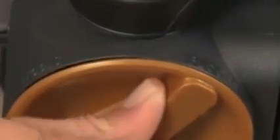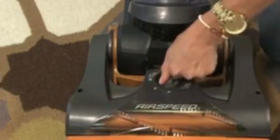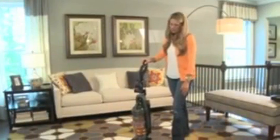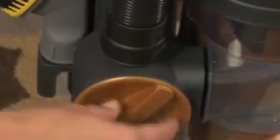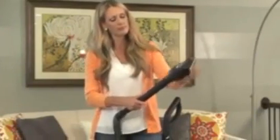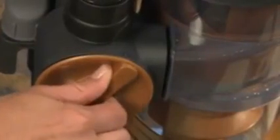To prepare your vacuum for cleaning floors, turn the Airspeed Airflow Control Switch to Floors. The Airspeed Ultra has a carpet height adjustment, which is used to clean various types of carpet. Begin vacuuming with the height adjustment at the high carpet position and then adjust it down to set it correctly for your carpet height. To clean using the hose and accessories, keep the unit in the upright locked position and turn the Airspeed Airflow Control Switch to Tools. Attach the desired tools to the end of the wand, and place the tools back into their storage areas when attachment cleaning is complete. Then turn the Airpath knob back to Floors.